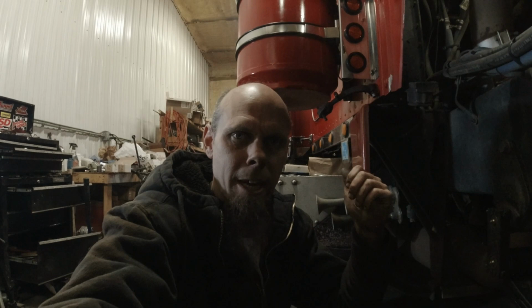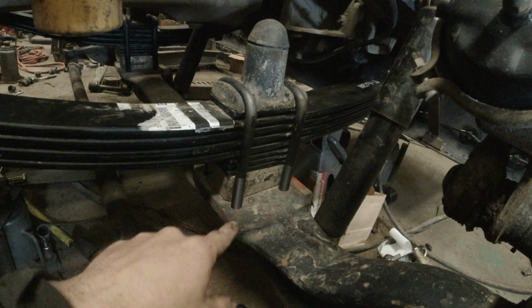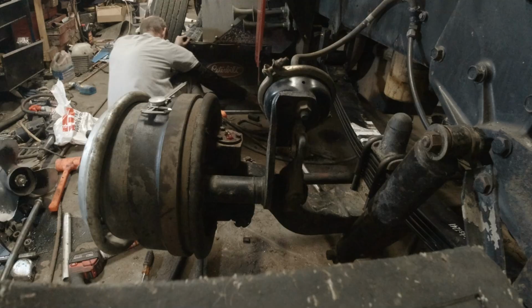Now, you do have to be careful on some things. It's not always accurate. Like, for example, the blower on my Jaguar. It's bolted down with bolts that are probably capable of torquing to 100-something foot-pounds, and the torque spec on them is like 12. So there are instances where you've got to know what the torque spec is, but in this application of U-bolts, you can torque according to the size and type of the fastener.